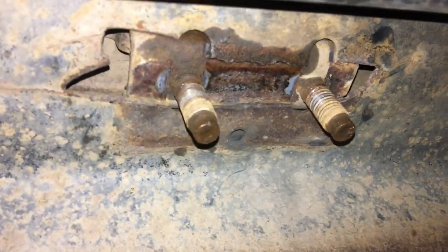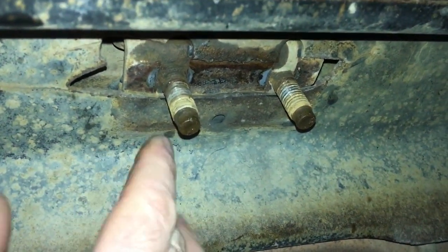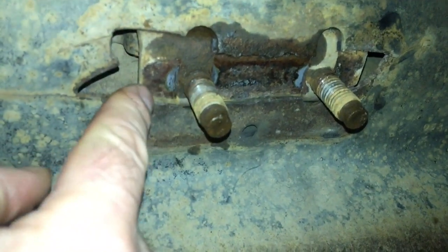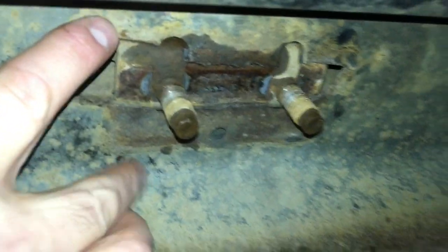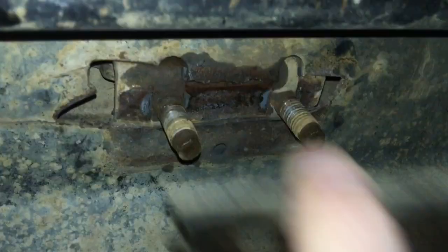We've got a pretty big hole and that rubber isolator chair is just about falling through there. I need a new piece ultimately. In the meantime, I might put a 1/8th plate up above, underneath this, just so it spreads that load out towards the edges of this crossmember where the strength is. And then I'll take this piece and weld it back on there. That's going to have to be good enough for now.